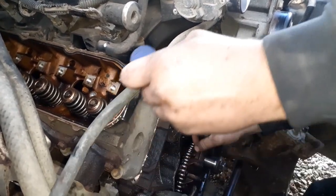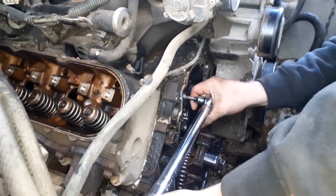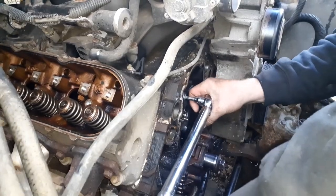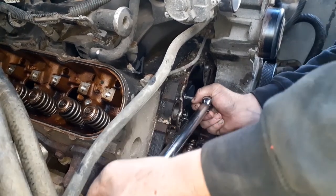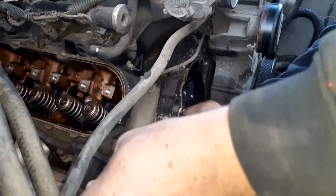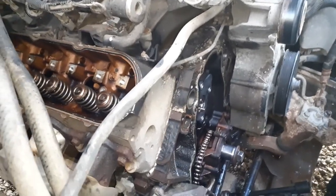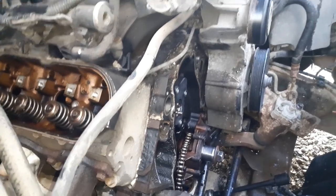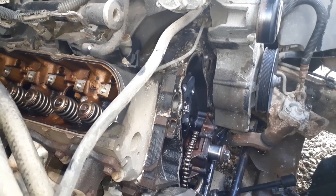That's the bad thing about that torque wrench - sometimes it doesn't go backwards. It seems really light - 18 foot-pounds, isn't it? Alright. Now you gotta put the cam gear in the chain. Go ahead and line your dowel pin up where it was before - that way it'll make it easier. Our dowel pin was at about the 3 o'clock position, so we're going to go ahead and turn the cam over to get it close.